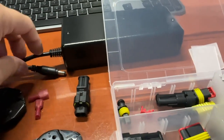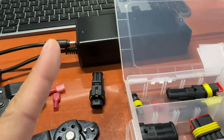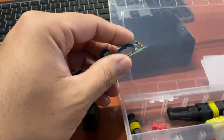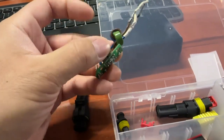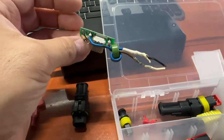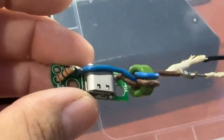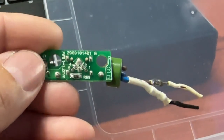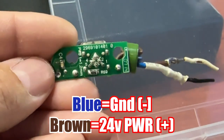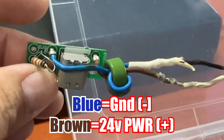You don't need any soldering if you try to reuse the barrel jack here. So the main point is which wires are which. I actually dissected an old Apple power supply off an Apple monitor, and this is the actual connector that's inside of it. As you can see, there's only two main wires going into it. It does have a resistor. There's only two main wires — I'll let you know here in a second which is going to be power and which is ground.